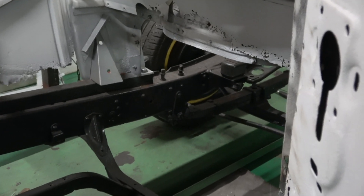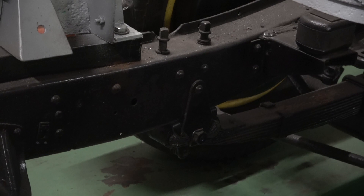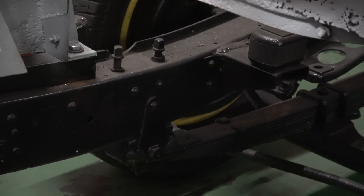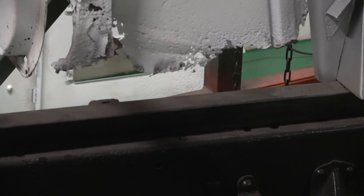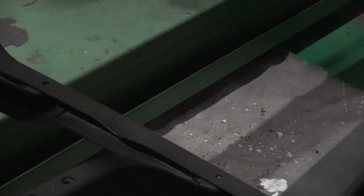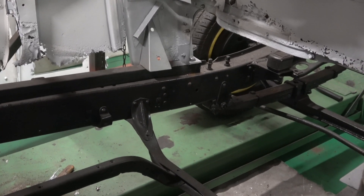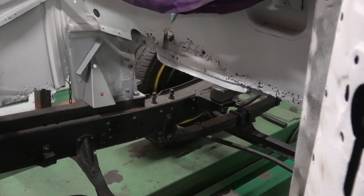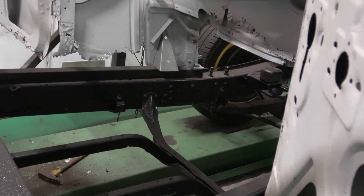We'll also weld it onto the front — there's a bolt in the front leg with a spacer crush tube in it, and there's another bolt going through the side where that triangle is, which also has a crush tube. So it's bolted there and there. It will be bolted on the front on both sides — that side still needs to be fixed up this week. We just want to make sure the bolts are in exactly the right place. Basically there will be eight bolts: one in the front, one in the triangular section, one in front of the A pillar, and one at the B pillar on each side.